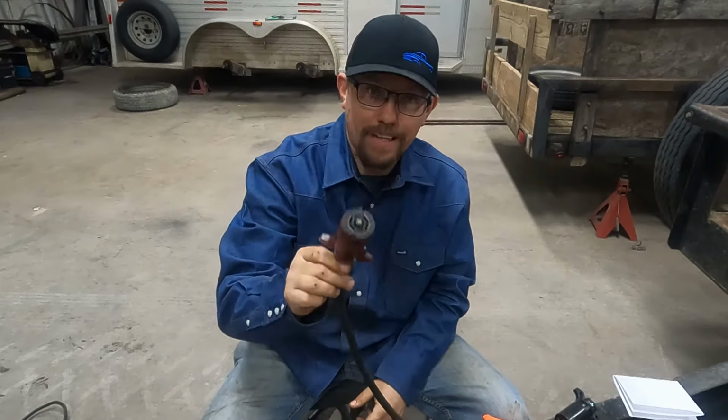Then we're going to twist it up, and I'm going to use a battery charger. So on this battery charger I have here, this is a large battery charger. Any 12 volt battery charger will work. We're going to put it on 12 volt, 2 amp, very small amperage, just because we're trying to isolate the ground wire. Then we're going to isolate every wire from there.